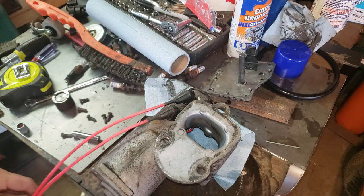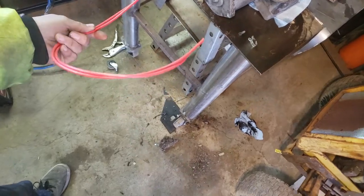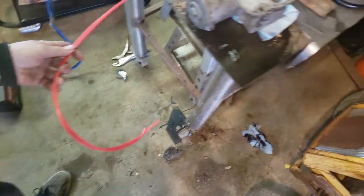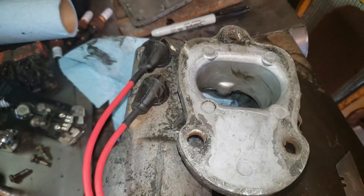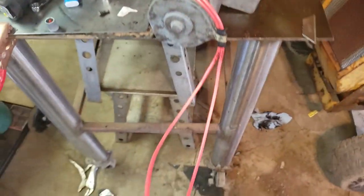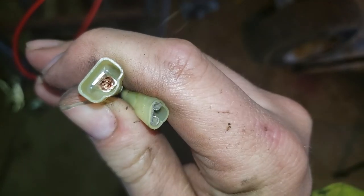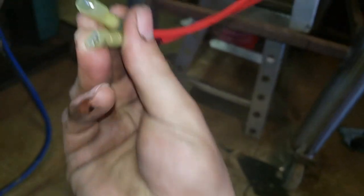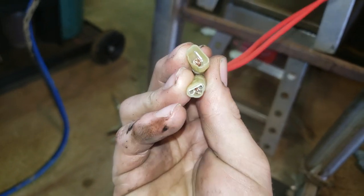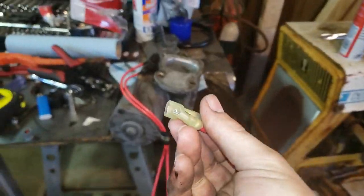And those are wired on here. So now I just gotta mark my tail wires. And the end of these wires is where there's a connector underneath the truck. I'm gonna do that same thing in case I ever gotta work on them, so that I can disconnect them right there. And a really good practice when you're wiring stuff like this, and one's a high and one's a low, you don't want to interchange them. When you wire them, wire the ends odd. Like this one's a female and this one's a male. So when I run my other wires along my frame, I can't accidentally reverse these, because on the other end, they won't fit. That's a good way to keep from mistakenly hooking up the wrong stuff if you're ever working on it again.